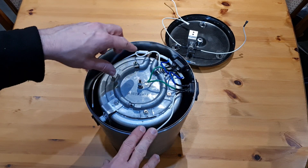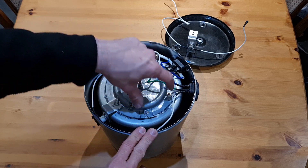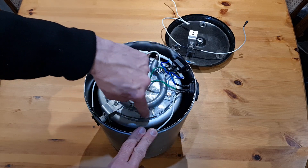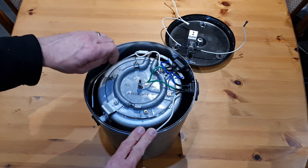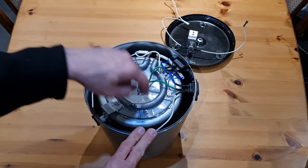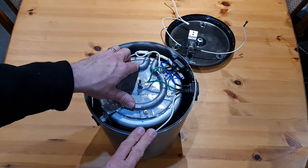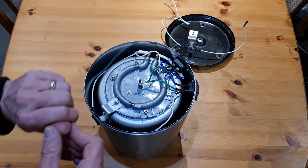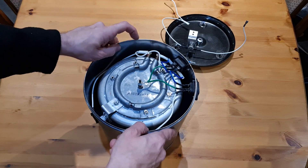There are no other areas in here, technically. If the heating element does go, you can undo these bolts and take it off with a flat blade screwdriver — you'll need to prise it up. You can see all the gunk underneath from the heat transfer compound. If you can get another heating element, clean the new one and apply lots of new heat transfer compound. Personally I'd say just buy another still, but it might be more cost-effective to just replace the heating element if you can get hold of one.